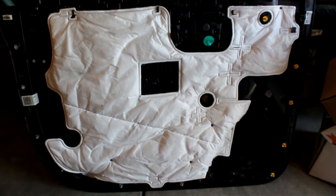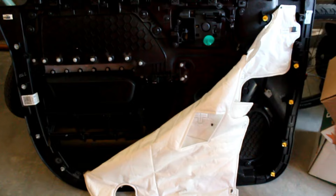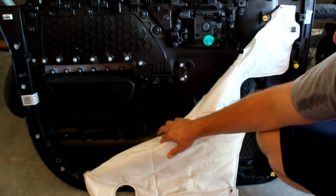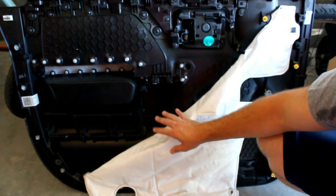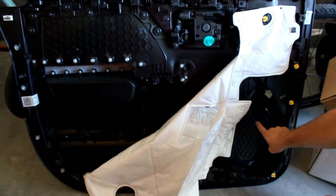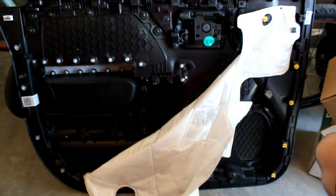You need to do a lot of test fitting. On the back side of the door panel there's white sound-absorbing material that can be unhooked from the top and peeled back so you can see the voids. I did some modification — I cut out some flimsy plastic framework underneath the grab handle area that wasn't doing much structurally, creating a cavity for the sending unit. The speaker sits at the bottom right, and I didn't want to place the sending unit too close to it due to possible interference.